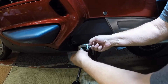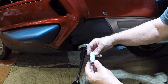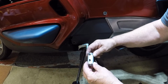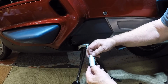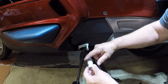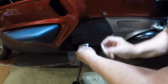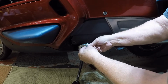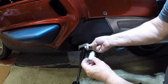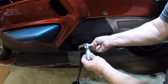Now for the sleeve that goes over to extend it out, I took another rod that I had poured, and I turned this, and I think it's 7/8 out on the outside. And when I had it in a lathe, I could only knurl it that far. I knurled it in that, and I put 4 set screws in there, so when I tighten these, it's going to be on there. So first, I put these 2 pieces on. Hold them. Then I can slide this on. And I want this out because that was in the jaws. I couldn't knurl it that far, so that'll go in the back.